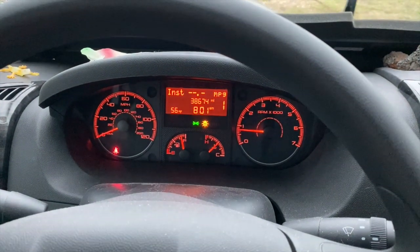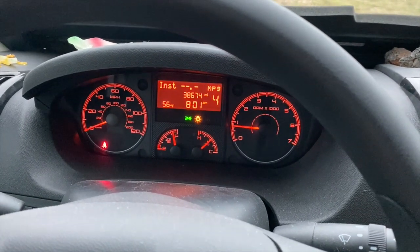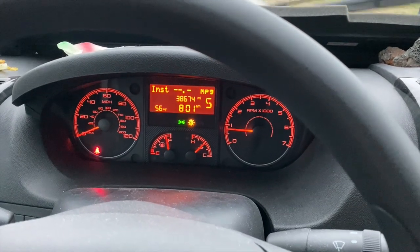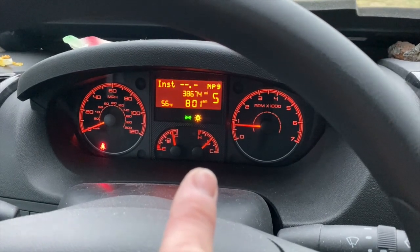What I'm going to do is juice this up through 1, 2, 3, 4 in the city and 5th gear on the highway. What this does is lock the gear from going no higher than what you set it at. When I'm decelerating on the highway, I have it locked to go not higher than 5th gear, so it would not go into 6th. As I come to a stop, it does downshift automatically back to 1st, and when I accelerate it goes all the way from 1 through 5 and stops in 5th gear.